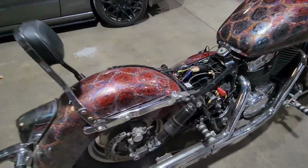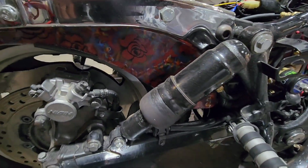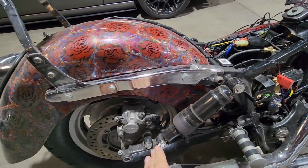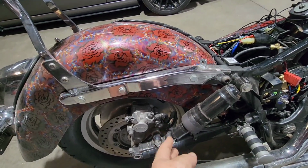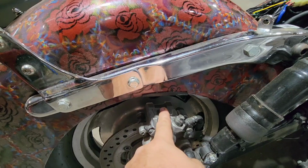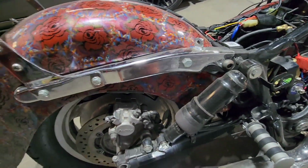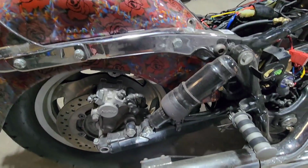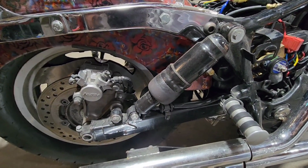So first to start off, these are C3 Corvette air shocks. Now, I moved the mount. It could have worked there, but I wanted to make sure if they were at full extension and full slam, nothing was going to get hit. Now, when we come all the way down, we're actually bumping on here. But if we didn't have that, because you can move the caliper back, we could come down another 2.5 inches. But it already comes down pretty low.